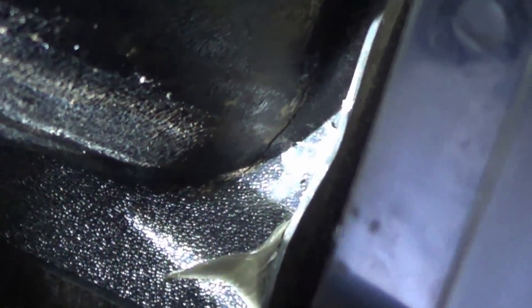Well folks, I'm kind of glad that I did this experiment, because once I started filling these tanks to the max level I found two leaks. This is the gray tank — I'm on the driver's side back corner right near the valves, and I got some dribbles coming out of there once the tank reached capacity. You can see right in that corner there's actually a crack. Then I went on to the black tank and the same thing on the other side — you can see it right on the corner as well. I was getting dribbles and there is a definite crack up in that corner too.